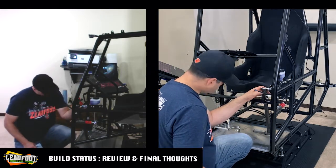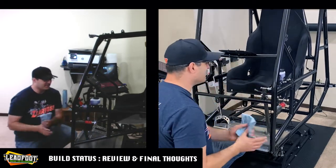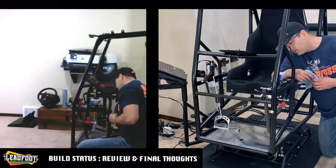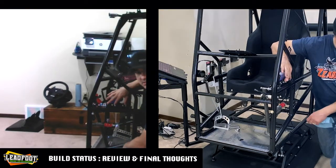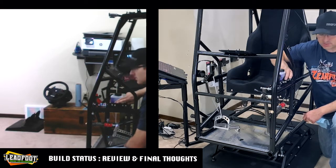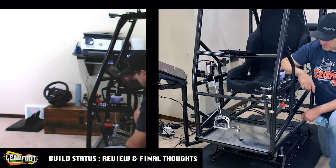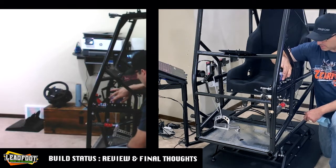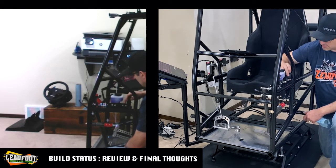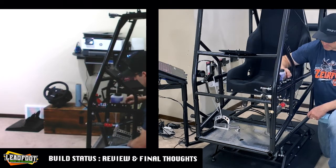And the master cylinder, I tell you, I didn't know if I was ever going to get done with it. So what ended up happening is, inside the frame right here is your master cylinder tabs, and you're supposed to be able to obviously mount the master cylinder directly to those tabs and have everything line up correctly. In this case, it did not. The tabs are almost probably an inch and a quarter back too far on the frame, so I had to go and fabricate a whole new bracket to put in here to move that master cylinder forward a little bit.